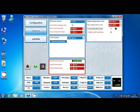Okay, next page, sensor. Well, here you can see a new flag named enable switch warning. Once enabled, the switch will show us that the ECU is switched over to petrol when it's in protection mode, if very cold temperature is detected on the temperature sensor. In order to make this feature work properly, low temperature protection must be enabled.